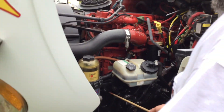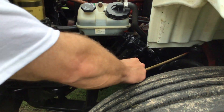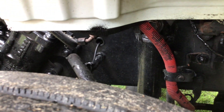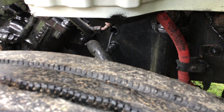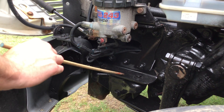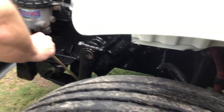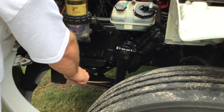My frame is properly mounted and secured. It's not cracked, bent, or broken. My upper shock mount is properly mounted and secured. All nuts and bolts are present and tight. It's not cracked, bent, or broken. My lower shock mount is properly mounted and secured. All nuts and bolts are present and tight. It's not cracked, bent, or broken. My shock is properly mounted and secured, not cracked, bent, or broken, and it's not leaking. My front leaf spring hanger is properly mounted and secured. All nuts and bolts are present and tight, not cracked, bent, or broken. My rear leaf spring hanger is also properly mounted and secured. All nuts and bolts are present and tight, not cracked, bent, or broken. My leaf springs are properly mounted and secured — they're not cracked, bent, or broken — and show no signs of scissoring or shifting, which would be an indication of a broken leaf spring.